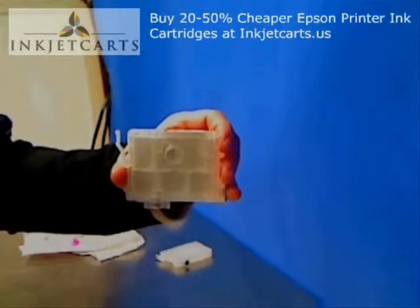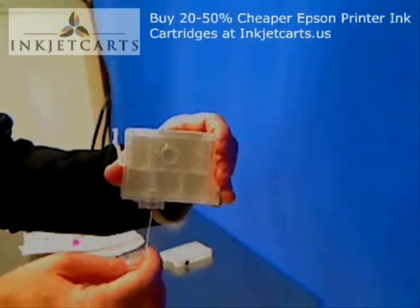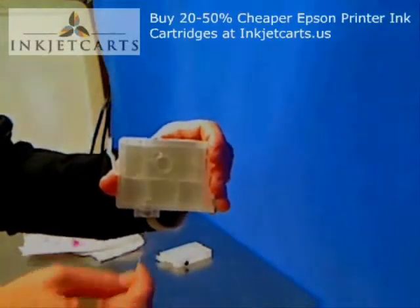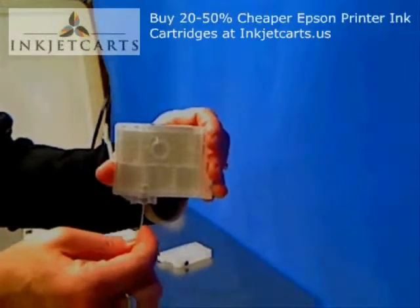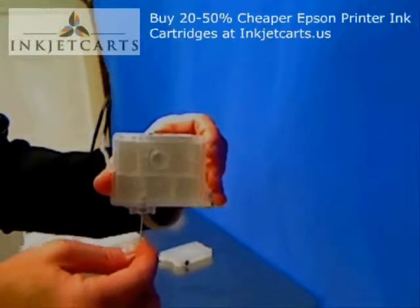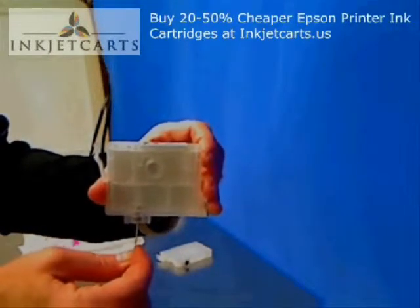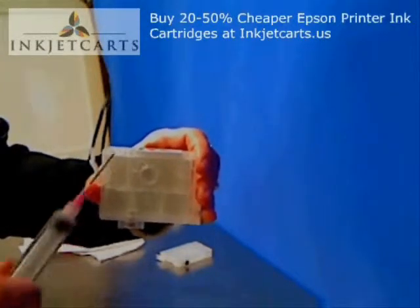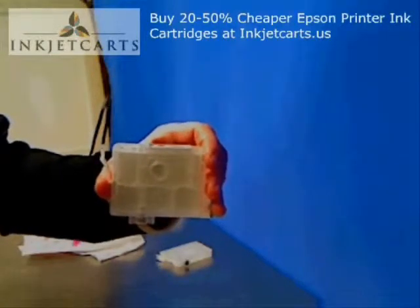The valve on this cartridge can sometimes stick. These cartridges are refillable in most models — 99% of them can be refilled right in the printer. You can see the valve operate and it's spring-loaded closed. If this valve ever jams in the open position and you try to remove the cartridge, it will leak some ink. So it's a good idea to put both plugs in the cartridge whenever you remove one, just to choke off air flow — you'll get no more than a drip out of it.